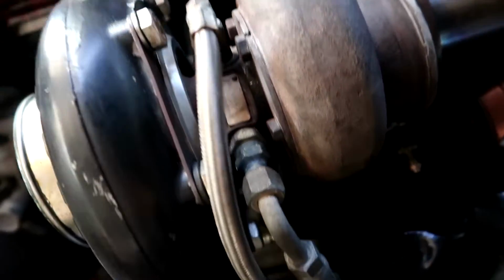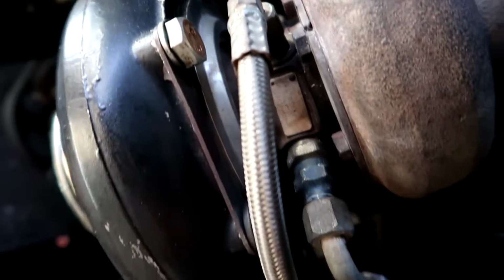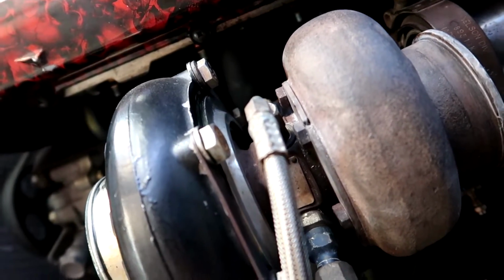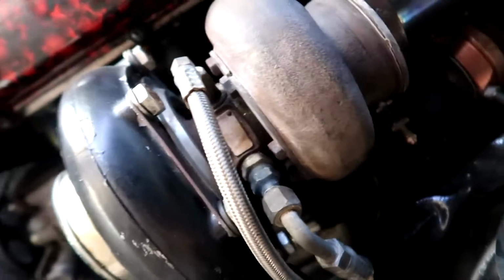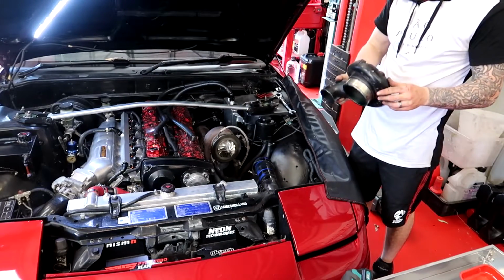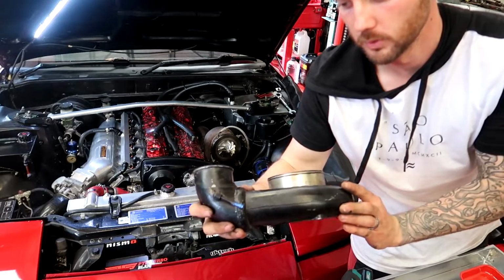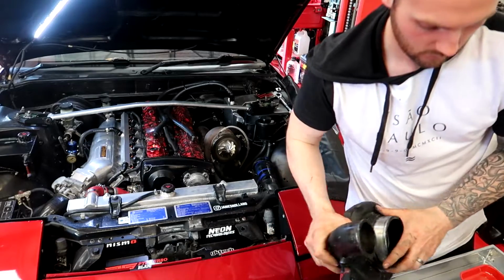And we'll be laughing. Also, this front housing, someone put helicoils in each one of the threads. They stuffed them up, so I had to tap them. They all got stripped, and I had to tap them all out to a bigger size. It works now, but that was a pain in the ass. That's the front housing off, and you see this is the elbow that's been welded on the end of it. So I'm going to need something similar to do the same trick.